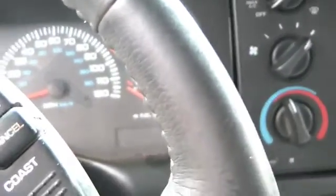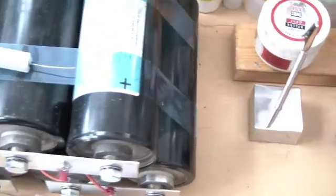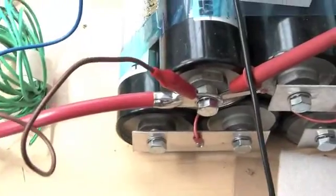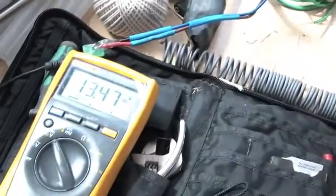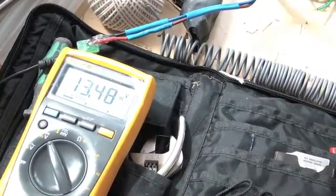Now I'm going to introduce the ultra capacitor — I'm going to stop for a moment and go get it. The ultra capacitors have been charging off of my solar panel. I've made a much better fitting for connecting the leads. I'm going to take my probes and check the electrodes — charging the ultra capacitors on the solar panel, we're at 13.46 volts. You can see they're just clipped here and connected out to the panel. One recommendation was that I put a voltage regulator or charge controller — I may consider that in the future. If you have recommendations for an inexpensive one, I'll probably go to a solar website or Amazon and find a small amperage one used for small solar applications.